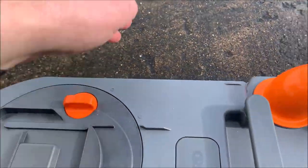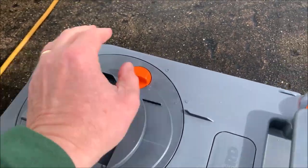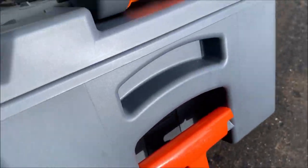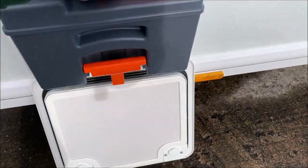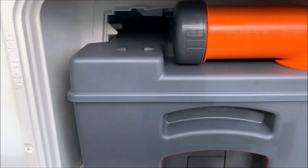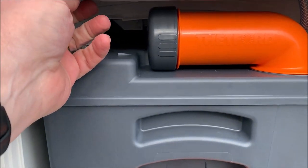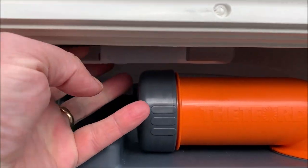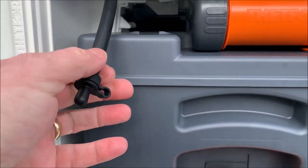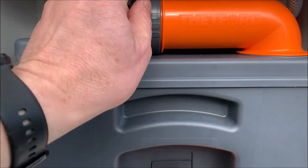Make sure that the flap is closed when you try to re-install the cassette. That orange handle is telescopic so you can transport it quite easily — put it back in and it clicks into place. Particularly important for winterizing, but good practice to flush it through every now and then anyway. To empty the reservoir of the pink rinse or water, there's a little pipe just in there — take that bung out and gravity will do the rest. Always best to have a bucket handy, otherwise you're going to get wet.